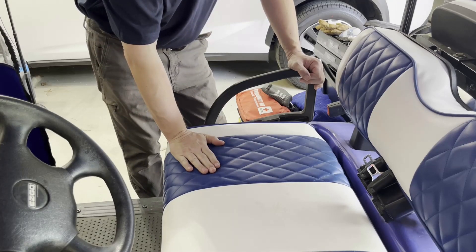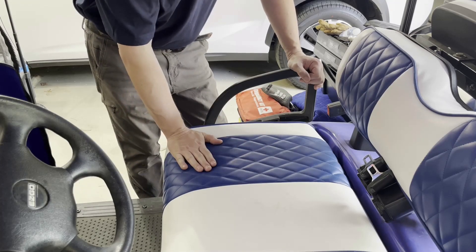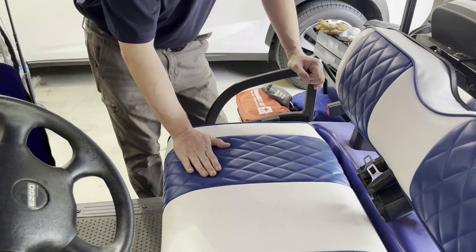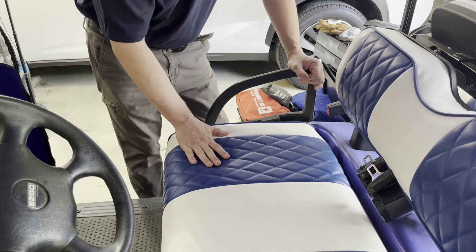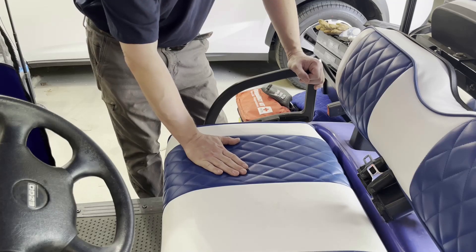The first step is to remove the golf cart from the garage. Currently, the batteries are locking up the engine brake, so we need to get into the control panel, put it in tow mode, and switch connectors to release the brake — otherwise we wouldn't be able to move the golf cart out of the garage.